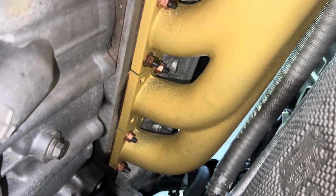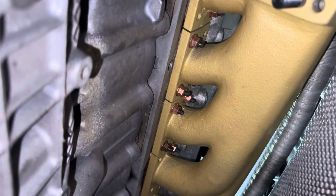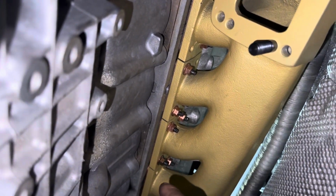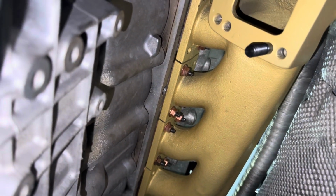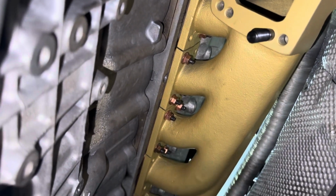No, I'm not missing studs. The way they make these blocks, I think it is the later M54s didn't have all those drilled out. Some of you guys will have 16, some of you guys will have them all, and that's just how it is. But 16 does work, it is plenty. Have boosted a car, same manifold with 16, no leaks.